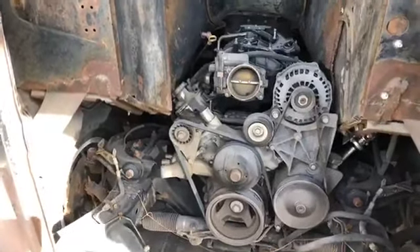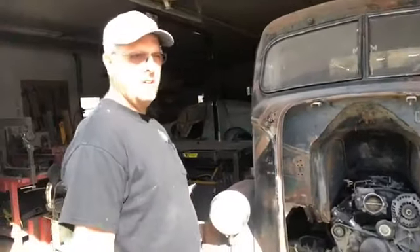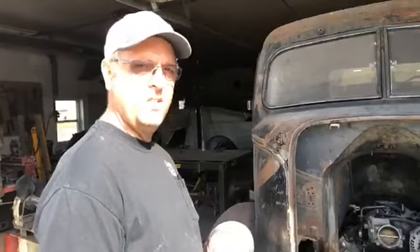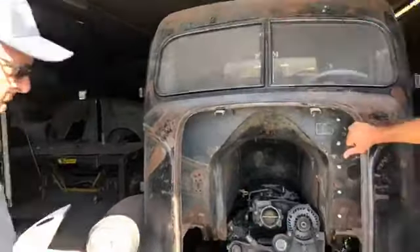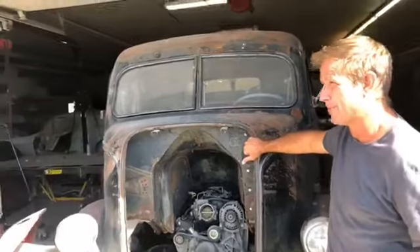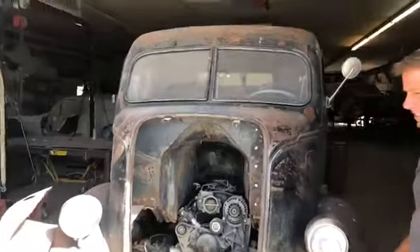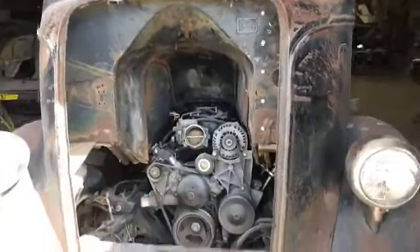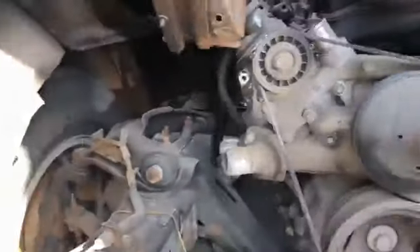Bobby Smith is asking, would using a van's chassis work any better for a COE? No — Dodge Dakota chassis, and I'm not a Dodge guy, but they just seem to be the way to go. They're heavy duty, and for a light truck they work good. So unless they wanted to use a one-ton chassis or something, there'd be no point. If they're going to make a pickup-type build, use the Dakota frame. It doesn't matter whether it's a Ford or what you're planting on the Dakota. I've done a Dodge on the Dakota years ago and it was a straightforward, pretty easy setup to get everything to do what you want it to do.